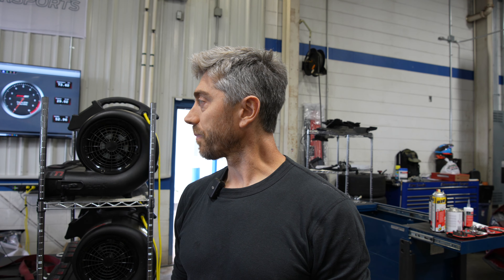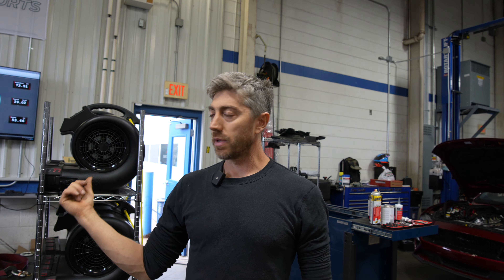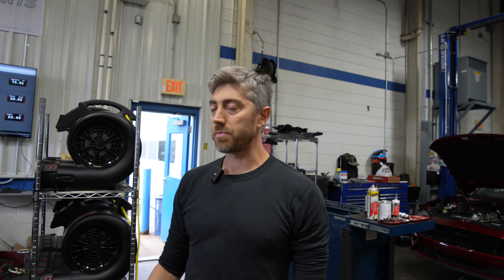This car made 444 horsepower to the rear tires, so it'd be really cool to see like a 460, but I don't know if we'll quite get there. We're re-establishing a baseline number for today because we don't want to compare to a dyno on a different day with different weather. Today there's no sun and it's a little cooler out, so we'll spin it up in these conditions, remove them, put the boxes back together, and see what kind of gain we get.